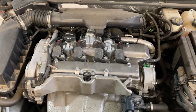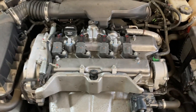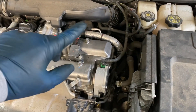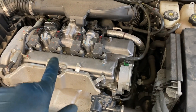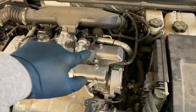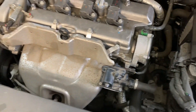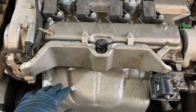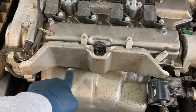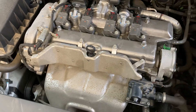Here's a quick tutorial on how to fix the common P0411 problem on a GM Ecotec engine, direct-injected ones specifically. This is a 2014 Impala with a P0411 code, which is for improper flow in the air injection system for emissions. The secondary air pump at the back of the engine is working fine, as is the pressure sensor. A common problem with these cars when they're not warmed up all the way or run short distances is that the air injection ports behind the exhaust manifold clog up with carbon deposits. We're going to take everything off, clean those out, and hopefully clear the code.